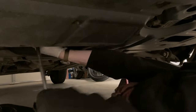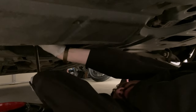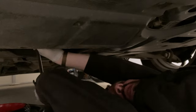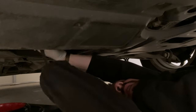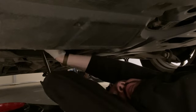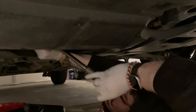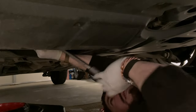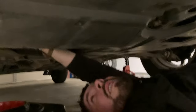Look at how I have to really go after this thing. When I bought this car it was on there so tight I was standing on the breaker bar with my feet applying 240 foot-pounds of torque. I resorted to buying a new one to free it, and I had to break the original one to get it off — it was a three-hour ordeal. Over the course of a couple of minutes — it takes like five minutes — I have to take the three-eighths adapter out, put it back in, go back and forth. You can feel it: quarter of a turn at a time, half a turn at a time. Now it's hand tight.